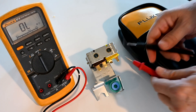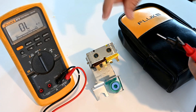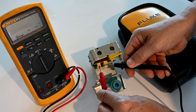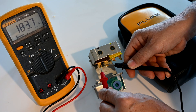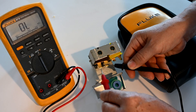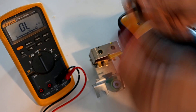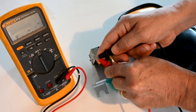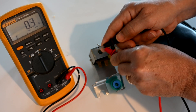To test your water inlet valves, set your digital voltmeter to ohms because we're measuring resistance. We want to measure continuity from one lead of each solenoid to the other. You want to see something in the couple-hundred ohms range — depending on the solenoid type it could be up to 500 or even 1500 ohms. You don't want to see 'OL' (overload), which means infinite resistance and no connection. And you don't want to see near-zero ohms, which means a short circuit.